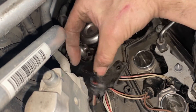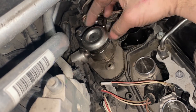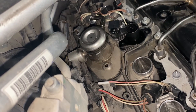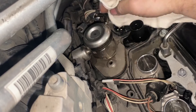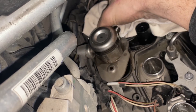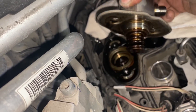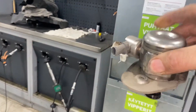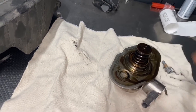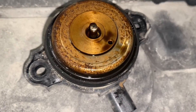First step is pulling this pump off — be very careful, there's a big bracket on it. When fitting these you have to make sure the piston of the camshaft lobe is at bottom dead center. Being an X5 there's no room with everything in the way. When building these back up, put the pump at bottom dead center — if you apply pressure when tightening without doing that, you'll bend and damage it.